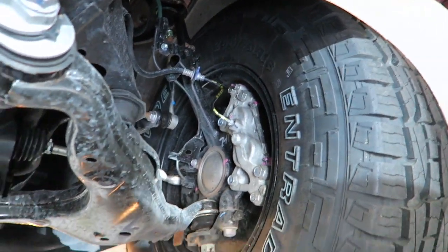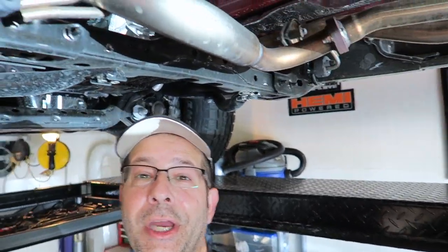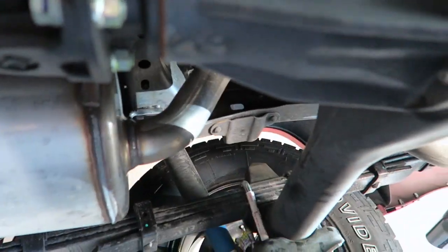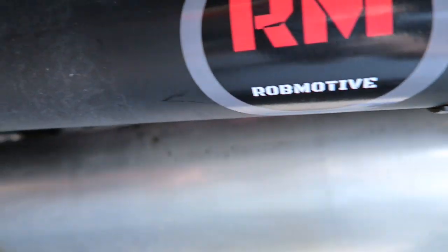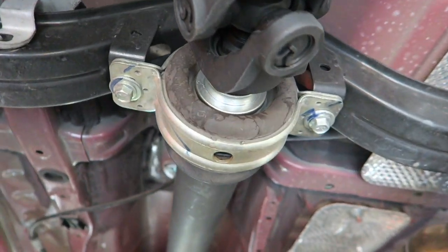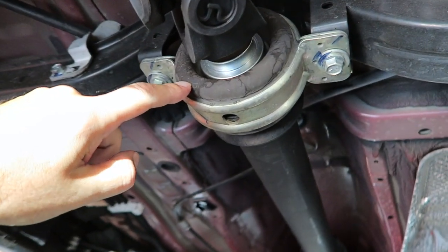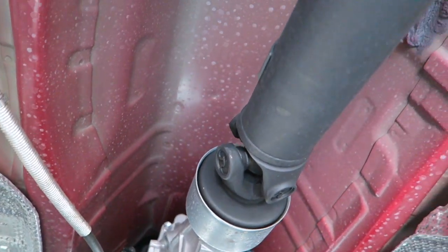So I'm not seeing any major rust under here as far as my truck goes, which is good. One more spot I wanted to check — the drive shaft. There's a little bit of rust where the two parts meet; it's no big deal. I don't see anything on the drive shaft itself. Someone mentioned a while ago about the joint leaking — I don't see any leaks of any kind, no fluid or anything there. Up the drive shaft, no evidence of any leaking either.